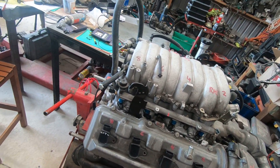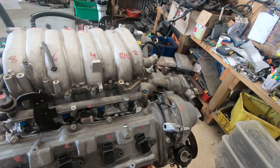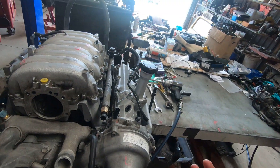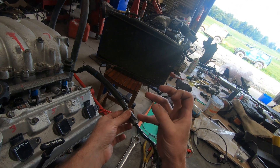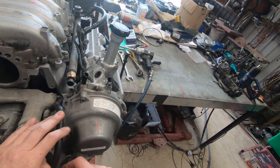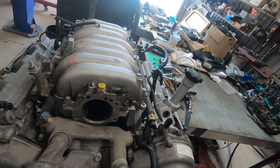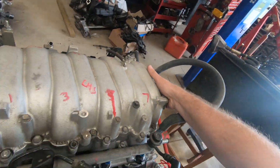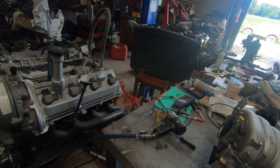I'm just really taking a bit of time here to check that I've undone everything. Of course, if you're in a factory car you'll need to undo this bolt here — they can be a bit ugly if they've been clamped up really tight. Undo the fuel out of it. You might have some water here, so you have to get some long-nose pliers into the throttle body. I've been stuffing around long enough — now we take the manifold off. That was so hard! I don't even think that was five minutes. Intake manifold off.